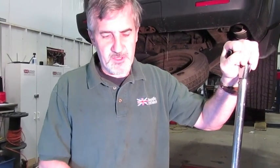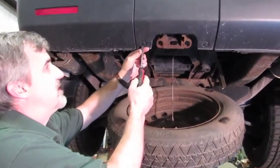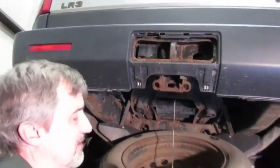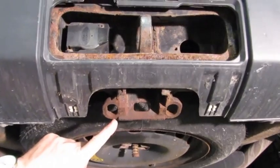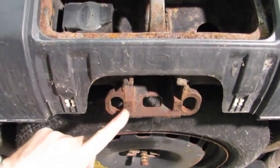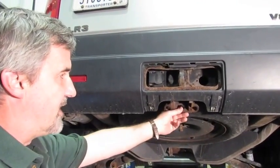We will be talking about specific torques when we bolt this up. First thing you'll notice is we've lowered the spare tire, which gives us better access to the bolts in the back. We'll take a straight blade screwdriver — or you can even pop the cover off using the side of a quarter — just pull that down and it comes out of the way. We already have the trailer harness installed, so now we're just adding the hitch. Grab a flat scraper and a wire brush to clean this area off as best as you can for a nice clean surface.